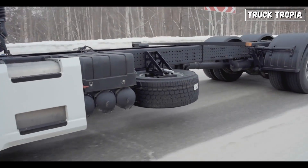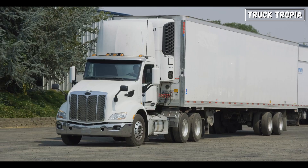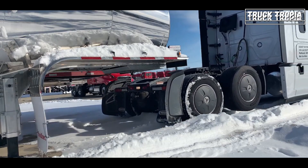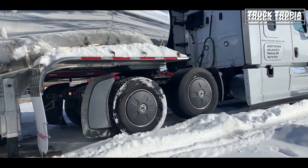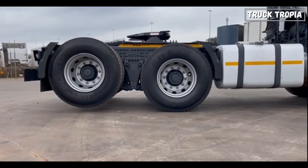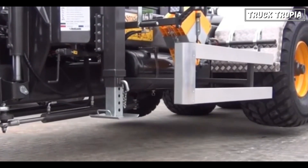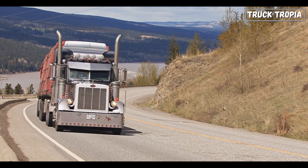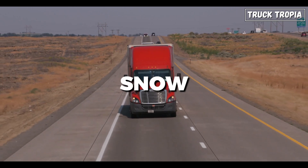But what's the point of driving with an axle that isn't in contact with the ground? Well, there are several reasons for this. Better grip and traction: lift axles can be lowered when the truck is fully loaded, distributing the weight more evenly among the axles. This increase in weight on the tires improves traction and grip, especially in adverse weather conditions such as rain, snow, or ice.